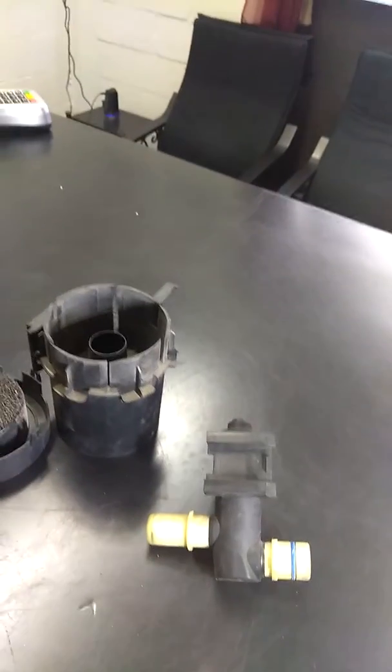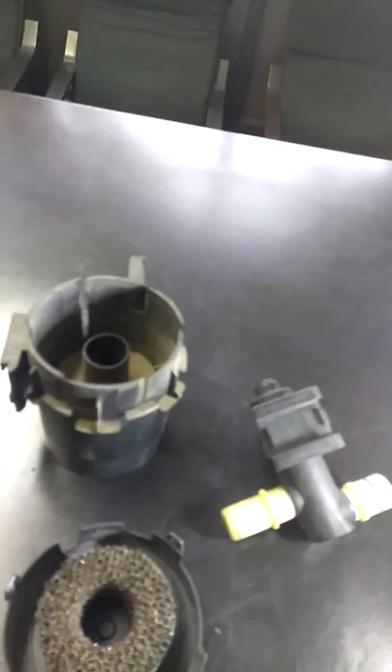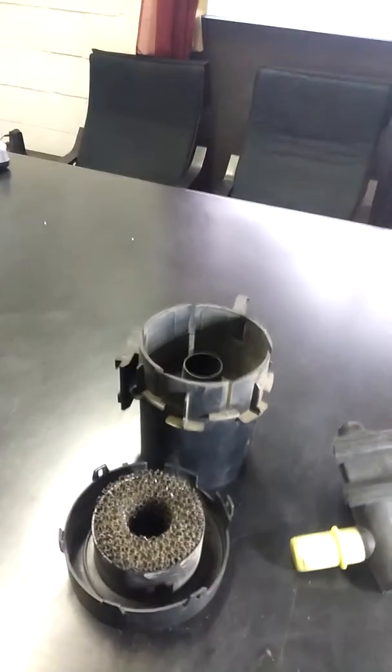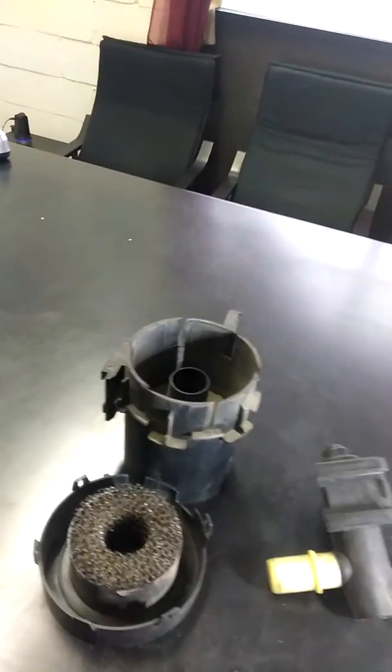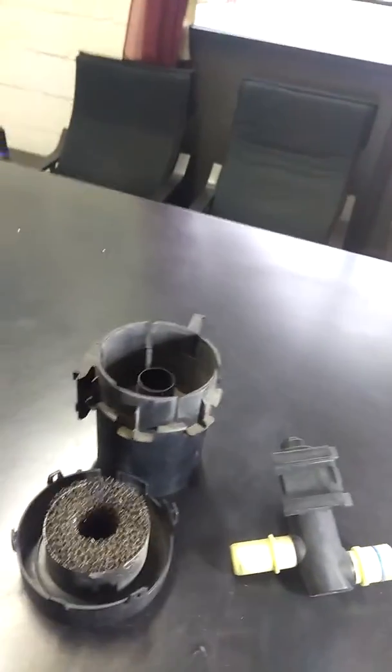Keep in mind, these are under your truck. So if you're driving through two feet of water, your vent solenoid is taking a beating. That's what you have inside of your GM and Chevy vent solenoids — they're pretty much commonly the same design. I've seen a couple different configurations, and I've also seen the Chevy and GMC come with a relocation kit. I don't think a relocation kit is going to help anybody — it may improve it or slow it down, but it depends on what you're using it for.